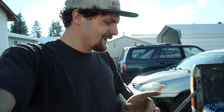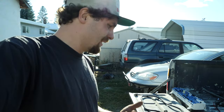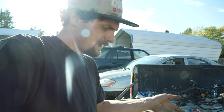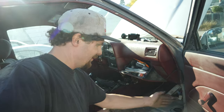The four-wheel drive indicator and reverse light harness is officially done. It's actually one of the cleanest harnesses I've ever built, and it's got plugs for absolutely everything. As far as where I'm feeding this harness, I'm not going out through the firewall — there's actually a grommet right here underneath the passenger seat that I'm going to feed it through to go directly to the transmission. Then it's a straight shot forward to my power source.